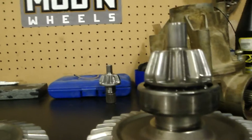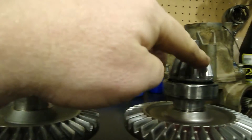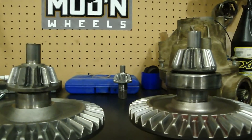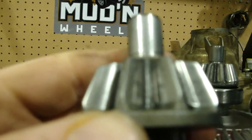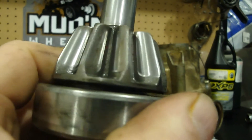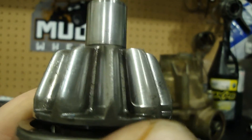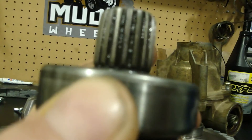Moving on to the pinion gears, not a whole lot of change here. One thing you'll notice is the pinion stub here is a bigger diameter than the 2012-2014 pinion gears. That's the typical wear pattern that you see on the old style G2 gears. And when you look at this, that pattern is evident already — the top of the teeth are starting to thin down. And if you flip this over, this pinion bearing is already toast.